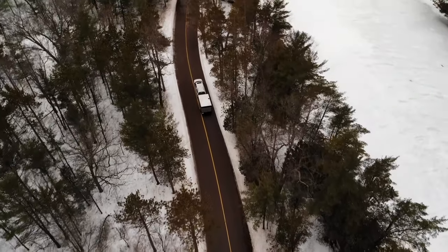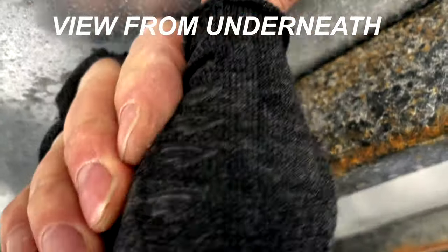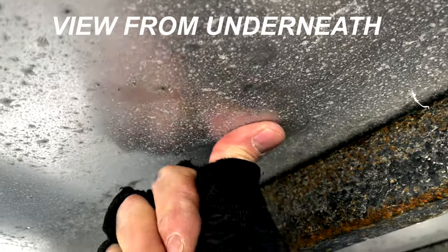However, I am changing that, but not for the reasons you might think. The flooring is very secure. I have no worries about driving with it — I just did the trip with Eddie and it held up great. The flooring does not move around. The reason I kept it floating was to prevent moisture from coming in by drilling holes. However, as I'm getting ready to put the finish floor on, one thing that bothers me is that the plywood does lift just subtly. When you step on it, you feel a slight compression — like a quarter inch — because it is floating, and from expansion and contraction, you feel it slightly compress when walking inside the trailer, and that really annoys me.